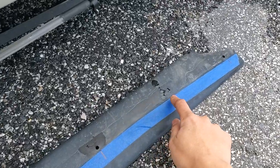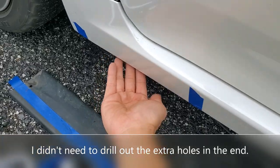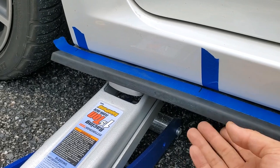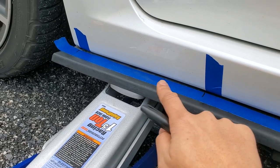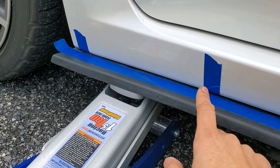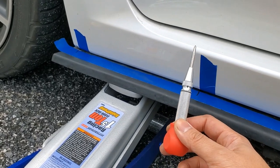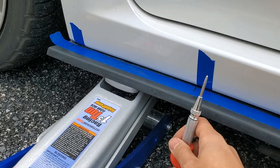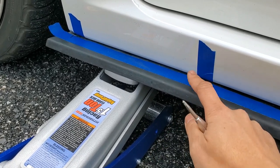As I said earlier, I'm going to be adding another hole right here and one right here because of the curve of the side skirt. Reposition the extension on the side skirt with your jack and then come in from underneath with a sharpie and mark through the holes where you're going to drill on the side skirt, then take this off and drill your holes. You want them to be kind of close to the edge but not too far. I also highly recommend using a center punch — I'll put a link to the one I use here. It's a spring-loaded one, and you want to do a center punch where the hole is going to be because you don't want the drill bit to accidentally walk and scratch the side of your side skirt.